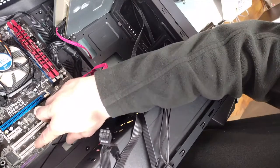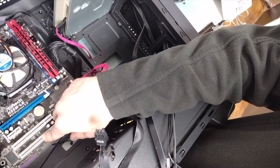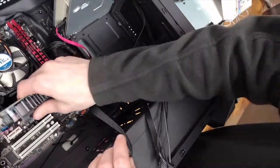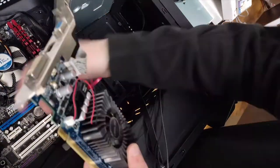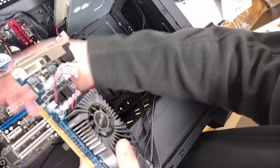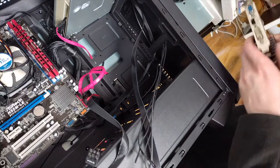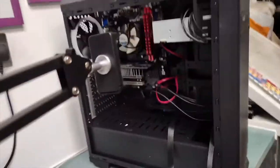But again, it's going to be complicated on this motherboard. You can use this actual connection for a USB 3.0 connector, but if I put in a graphics card, let's see, this is what came originally. If I slap that in, if you put any cards in, you don't have space to put anything in here unless you can get an extension. But yeah, unfortunately this computer doesn't have a 3.0 connector, which kind of sucks actually. So okay, technically the machine is built.